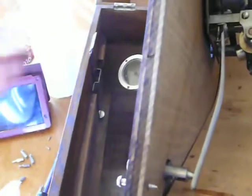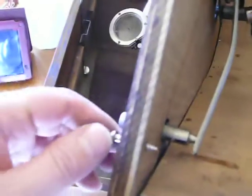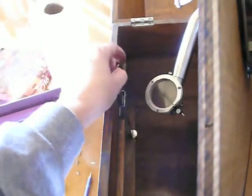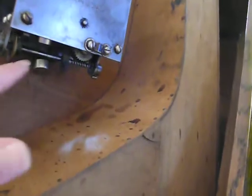Make sure it's winding and playing and everything's good, and then you can bolt it back down with the 6 anchor screws, or however many you have on your unit. And then once you've got those anchor screws back in and the crank on, you can put the screws back on the lid, and then you should be good. But that is a way to grease and lubricate and repair if it's a simple fix like that.